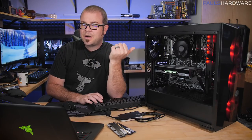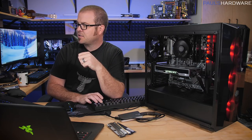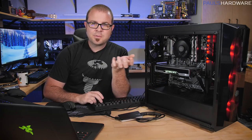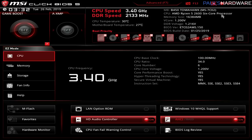The BIOS update completed. The system automatically restarts afterwards and I'm tapping the Delete button to get back into the BIOS because we're not quite done yet. Actually, before any of that, I'm going to install a 16 gig memory kit because this kit is 8 gigs — I intended to install a 16 gig kit but the kit I had was the wrong size. The system is starting back up again and I'm tapping Delete once again to get back into the UEFI. Sometimes you'll get a message like this if you swap out memory or a CPU — it just means the system recognized that something changed and wants to go into the UEFI to make sure all settings are appropriate. Memory size is now up to 16 gigs, so that's awesome.